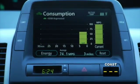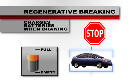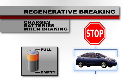The key to the car is to drive it consistently. We've got a stoplight coming up in the distance, so we're just going to coast up and gently, gently, gently brake — use the momentum right to the last moment. If you listen carefully, you'll hear a little hum as we come to a stop; that is the secondary electric motor regenerating power back to the primary's battery — that's regenerative braking. It varies according to driving conditions, road surface, and temperature. This is a very temperature-sensitive car; it likes it above 45 degrees Fahrenheit. It has a little different personality in the winter, but it still does very nicely.